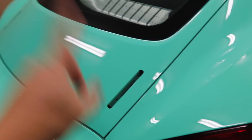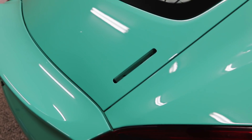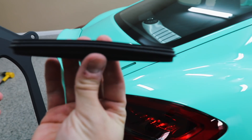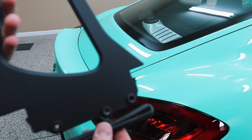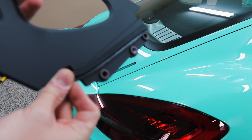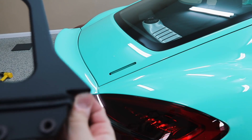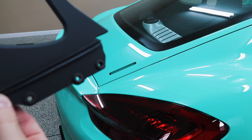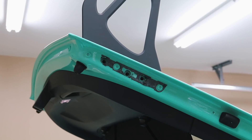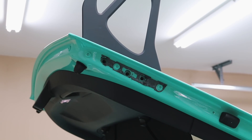We're back to basically a regular Cayman. Now we're going to get the new uprights put in — it's basically the reverse procedure of what you did before. You have the weather stripping from the old uprights; pull that off. The ribbed piece — the top — is going to go onto your wing support, so you just pop it up on there and get it up through. It should just pop up over the top like so. Now you're ready to install — just put the bolts back on, put a little bit of Loctite on there to hold them in.